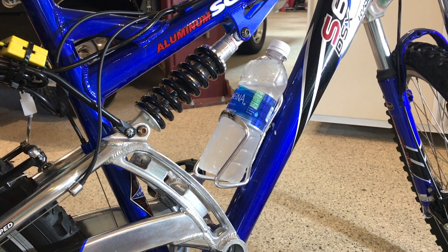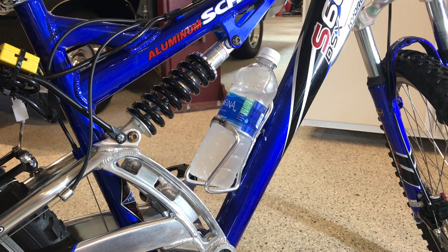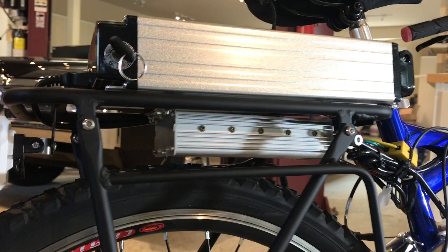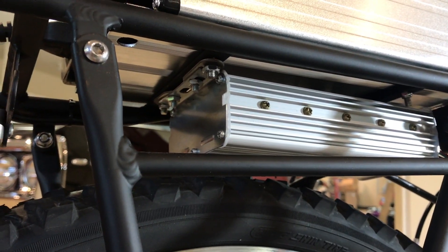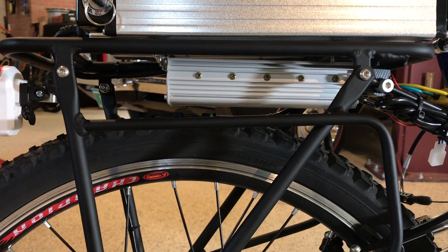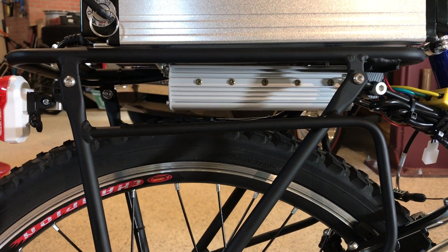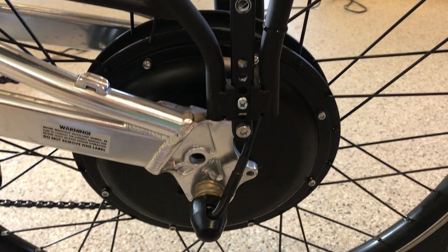The instructions and pretty much everyone else seem to mount their controller where the bottle mount normally goes. But I still wanted a bottle mount, and I did not want the box and wires down there between my legs, so I mounted the controller on the underside of the battery tray. I used a couple of small mounting brackets and machine screws to mount it from the underside so that the battery slide tray could still function. I don't have a great deal of clearance between the controller and the tire, but since nothing moves or flexes in the suspension at this point, an inch should be as good as a mile as long as the tray doesn't collapse.